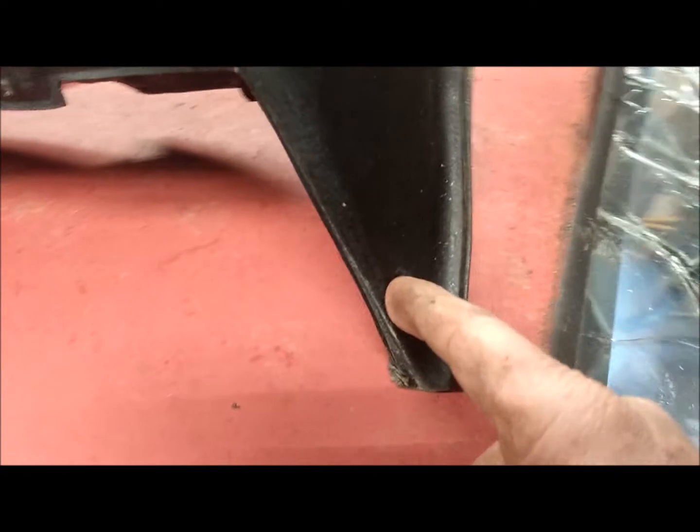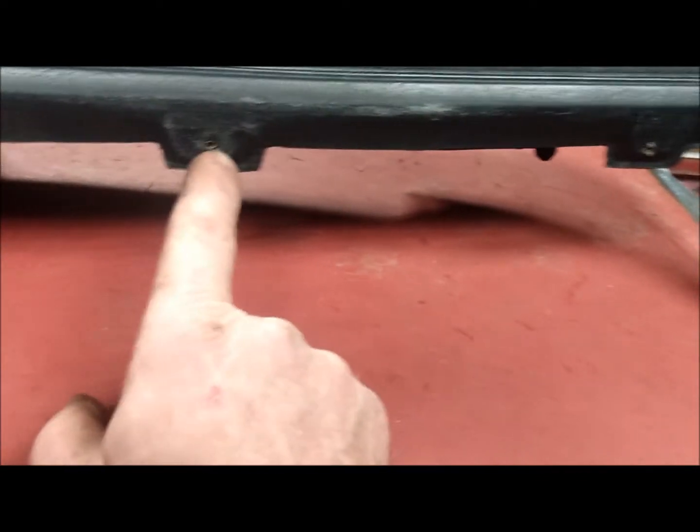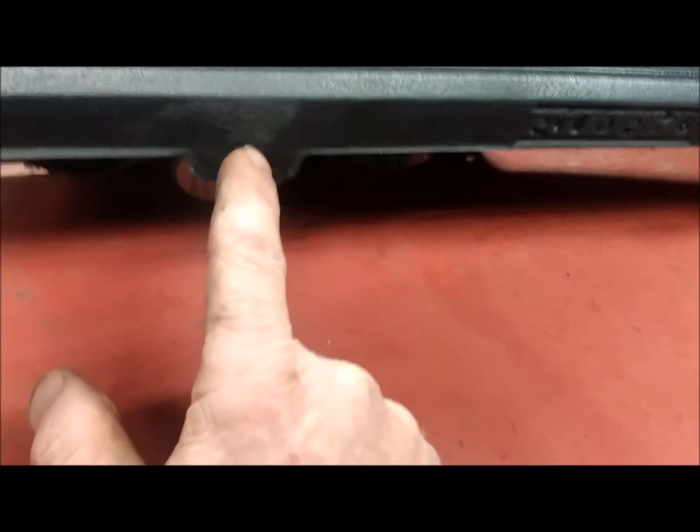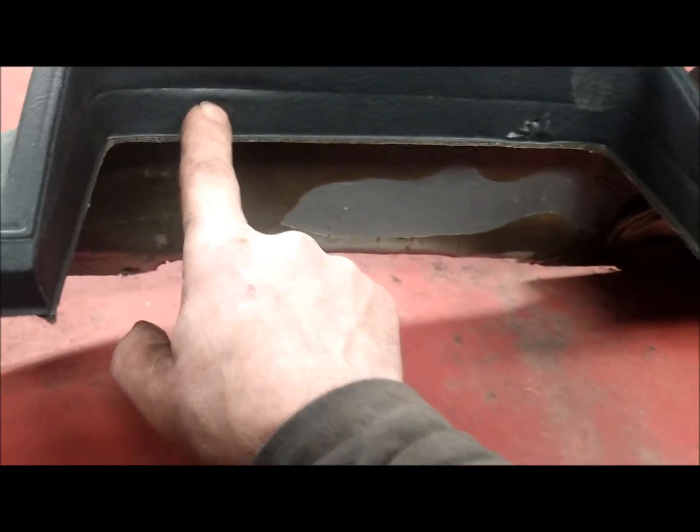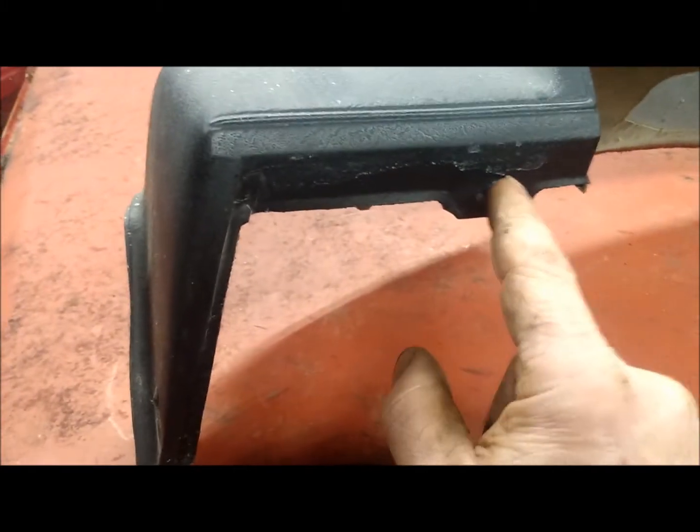Then you can just remove it. Of course this car the windshield has been pushed down and the seats are pushed up, so there we have it. Flip it over — looking at the dash pad on its side, you got a screw out here by the door, one of the glove box screws right here in the center under the console light, two here above the speedo gauge cluster, and that sneaky one underneath the headlight bezel switch cover, plus the one on the side held in with a clip. Disconnect your radio, there's a clip back there — lift it up evenly with two hands, pull it straight out, and then you have everything exposed.